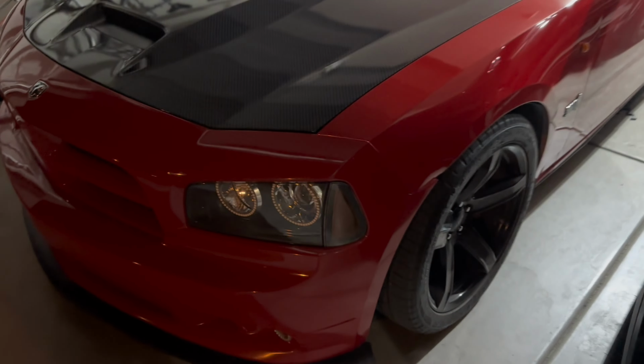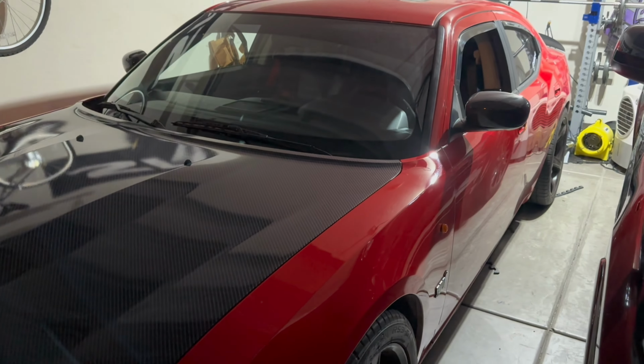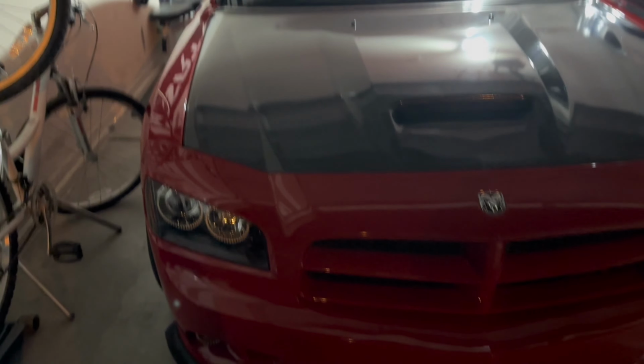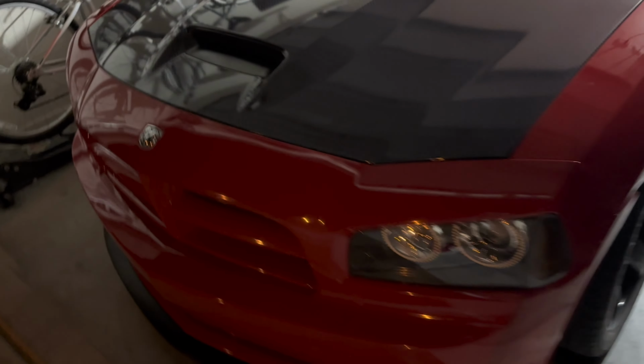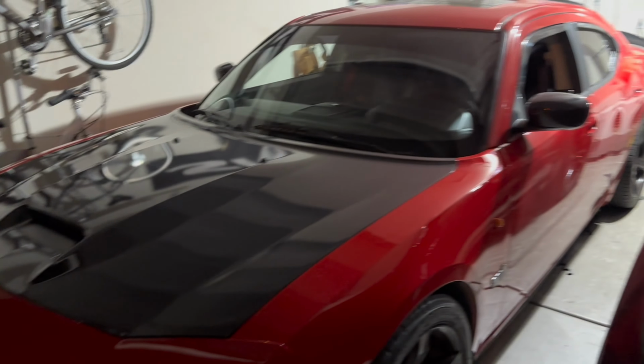Sweet. All right, guys, so I've been home for a while now. I checked coolant, levels were all good. No issues with the car. I was idling at Taco Bell for like 20 minutes. There's a long line. Temperature stayed anywhere from 210 to 212. 213 was the highest I saw. Did a couple pulls on the highway, got up to like 217, 218, and immediately went back down to 210, 212. So thermostat's all good. Thanks again to Mario Marcos for helping me out, and Mario's dad too, Jose. Thank you as well for helping out changing that thermostat. Car is running good now.